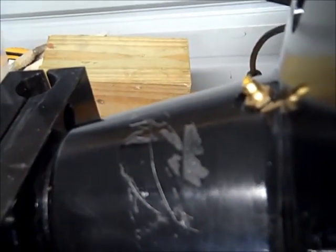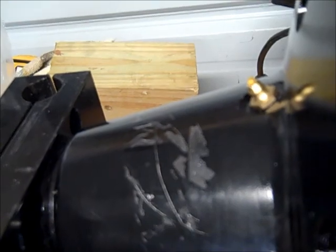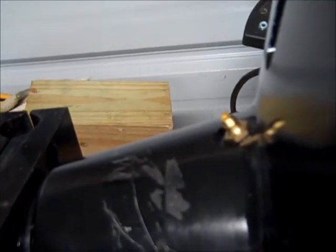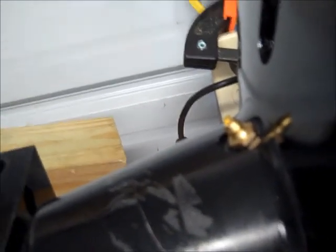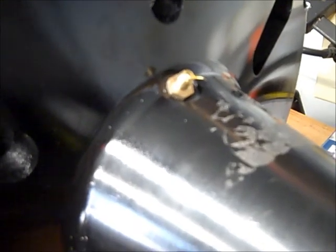Then after I bolted it all together, if you see here, there's a grease zerk here and another one over here. That's for the bearings, the roller bearings that you already packed. Squirt that full also. It'll keep it greased really well. I'm guessing that's where you should probably be doing your maintenance greasing occasionally on those areas. I haven't got directions for it. I contacted DNA. They said they didn't. Well, they told me they had some and they'd send it to me, email it, but they haven't yet. I couldn't wait around and wait for them.